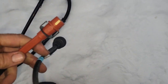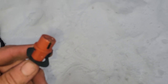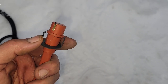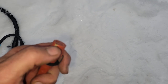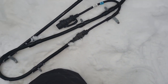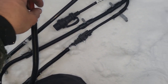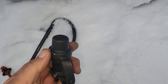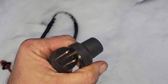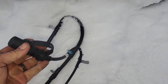There's the plug, guys. This is the part that goes into the heater element. They used to have a threaded part that would spin on there, but now it just has these clips that actually grab hold of the threads on the heater element. It's got two contacts in there and it looks like there's a ground on the side right here. The wire harness comes with all of the little tabs in order to plug those into the holes in the frame. And then you've got a cap with the 110 outlet — while it's not being used, you want to make sure to keep that thing clean and keep that cap on there.